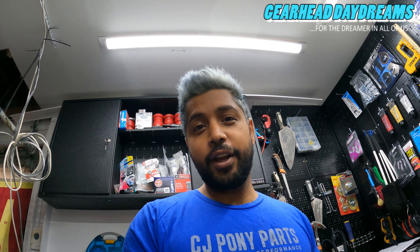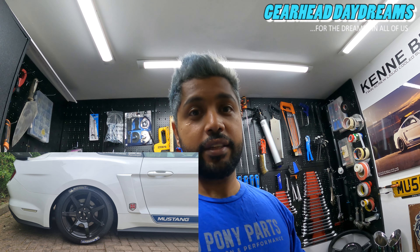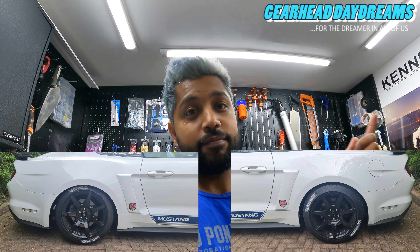Something happened which left me with no choice - I have to work on the car. A couple of days ago I was driving, going around a roundabout, and all of a sudden I got what I can only describe as a flat tire feeling - the car went jittery. I checked my TPMS and there was no loss in pressure. I knew something was wrong with the rear end. I pulled in and looked at the driver's side rear - passenger side rear for the American guys - and the camber was ridiculous. I'll post a photo so you can see the difference from how it normally looks.